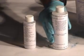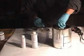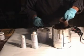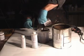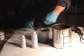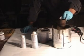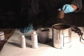Both bottles are marked with increments on the side to allow you to measure out the appropriate amount of hardener and catalyst. We will start by measuring out the proper amount of the copper paint. This is much like the B coating except it has a much higher concentration of metal, and by adding the hardener and catalyst it will create a very hard metallic surface that can be sanded and buffed to a better shine than the B coating.